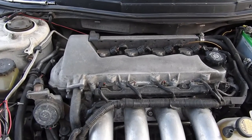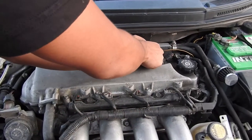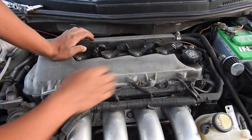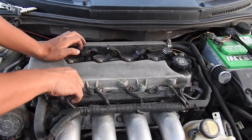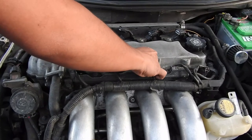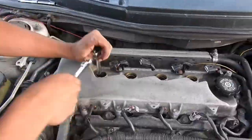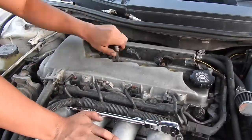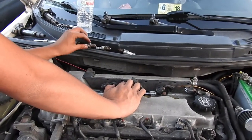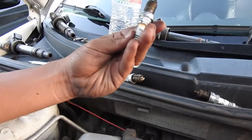The first thing I'm going to do is unplug all these coils. Sometimes it's easier with a screwdriver, but luckily I was able to get them all off by hand. Disconnect your injectors because you don't want fuel leaking in and flooding the cylinders while you're doing this test. The spark plugs are already out, and these will need to be replaced — you can tell if they start becoming yellow, then you're going to need new ones.